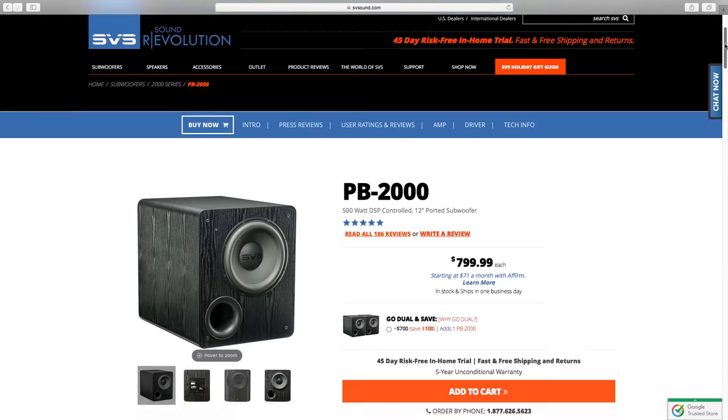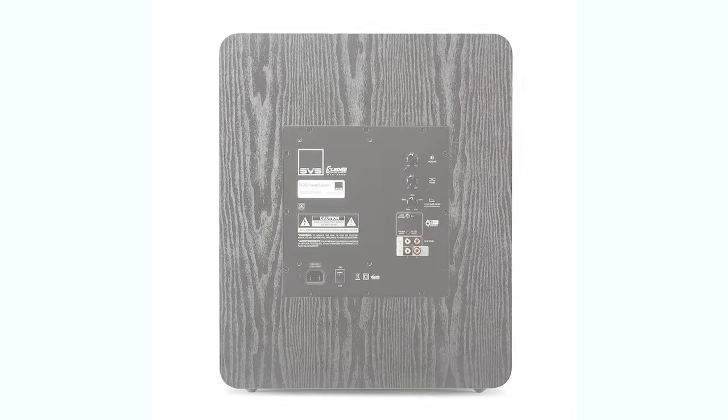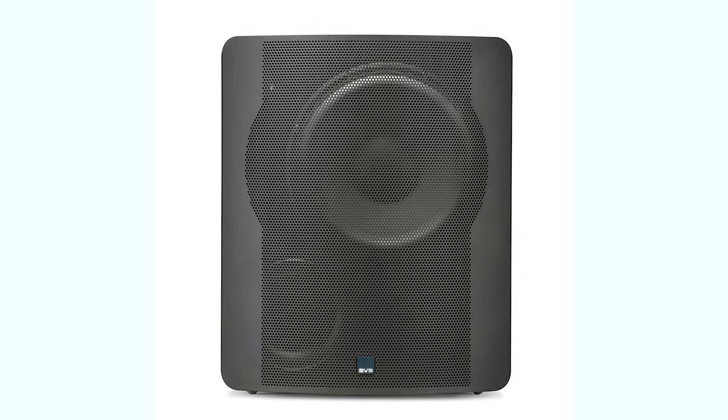If you can save up and are serious about bass, I highly recommend buying an SVS subwoofer — ideally the PB2000 at $800 brand new. They're in a league of their own and can even sound better than a commercial theater in a home theater room. As with any subwoofer, make sure it's set up properly: set the crossover on the subwoofer to max so it's not blocking anything. Set your AV receiver's crossover frequency to 80 hertz for all speakers — that's what THX recommends. Set all your speakers to 'small' rather than 'large' in your receiver settings so all bass gets redirected to the subwoofer, which is best equipped to handle it. I recommend the BIC F12 for anyone on a budget. If you can save more, get the SVS PB2000. But for those just getting into home theater or wanting better movie playback, I'd definitely recommend the BIC F12. Thanks for watching.